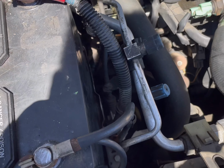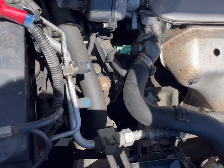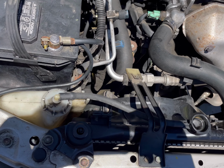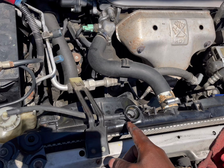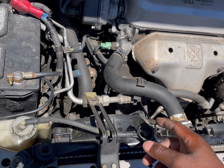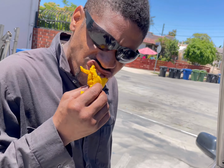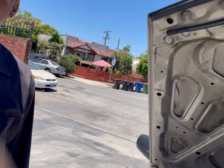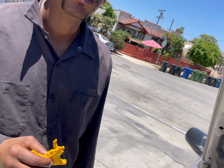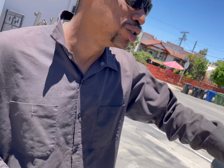Make sure there's no bubbles. So I'm pouring it in here, and I'm observing this flow out coolant. And once it's flowing out with no bubbles, then I cap that off, and I continue to pour radiator fluid in here, a little bit more to make sure it's full. Then I turn on the heater and wait till it blows out hot air consistently, because the heater uses the radiator fluid that transferred to the back of the firewall, which transferred to another radiator that's smaller, and then there's a fan that blows the hot air from that smaller radiator into your cabin to warm you up.